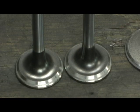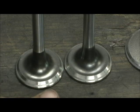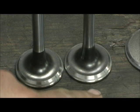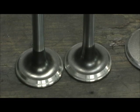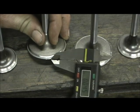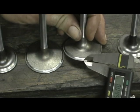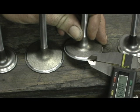Here's an amazing coincidence: when you get them like this, all in the same place, when you do the stem height you're going to be surprised at how close the stem heights are. It's kind of like checking an algebra problem by going in reverse. If they're all the same width and in the same location, then when I take my stem height gauge, they should all line up with about the same stem heights. Looking at the two intake valves — I'm just spot on with this, at 45 thousandths. I come over here to this one — just right there, maybe a thousandth bigger, 46 to 47. Just right on.